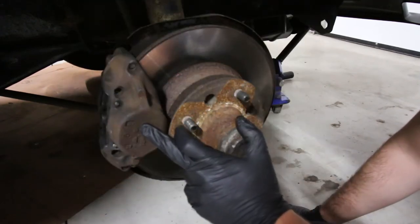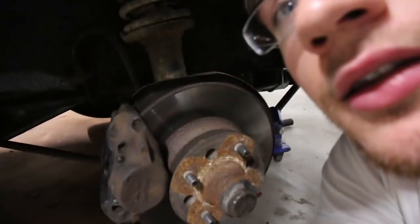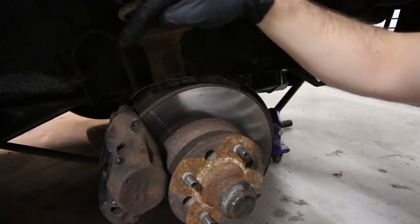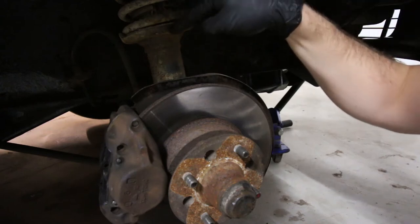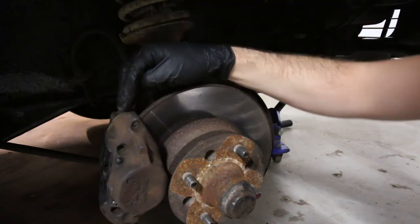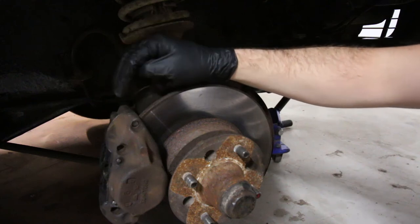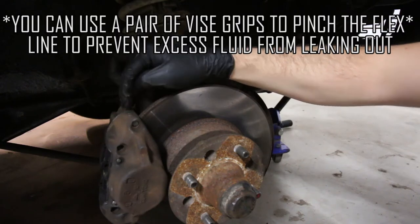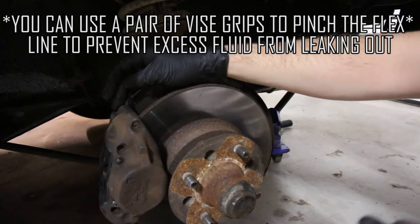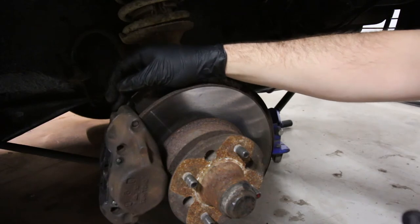The caliper needs to come off. There are two 17mm bolts. The issue is the flex line is up here — the flex line doesn't go to the caliper. The flex line goes to the strut itself, and then there's a hard line going from the strut to the caliper. Meaning, to take this caliper off I need to take off the hard line, meaning brake fluid is going to go everywhere and I'm going to have to bleed the braking system. So that's just another step involved. It's not the most thought-out system I've seen — there's a flaw in this design — but we can do it, we'll survive.